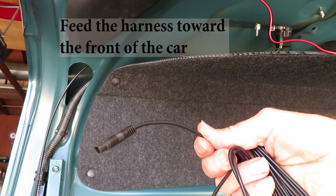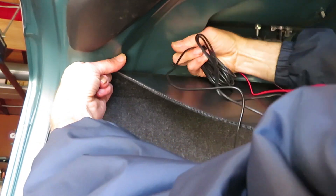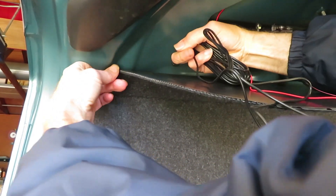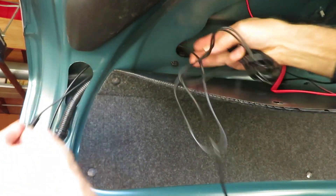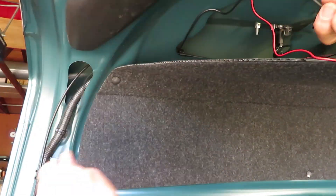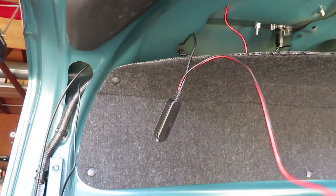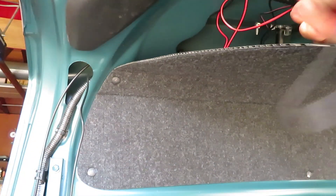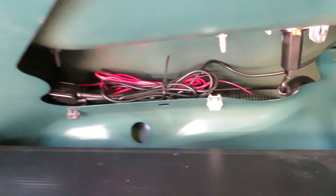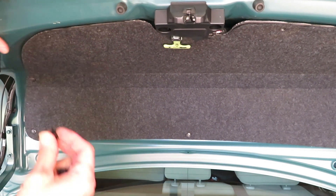Now let's feed through the end that goes to the monitor. We're going to feed this wire through — quite a few feet of it. I think you should be able to do a pickup truck with this. We won't need that much. Then we're going to plug in our camera to this black box. We tucked away a lot of the spare wire here in the trunk. Before we go any further, we're going to test this — flip it into reverse and our monitor comes on. Wiring's good. We can start covering it up now that we know it's going to work.